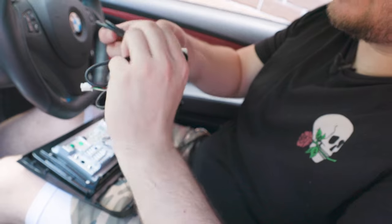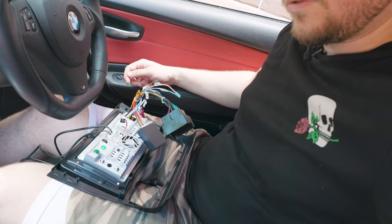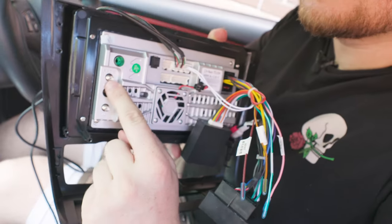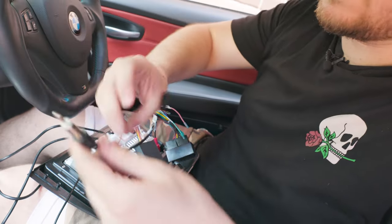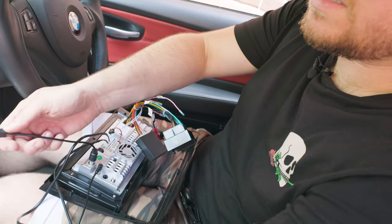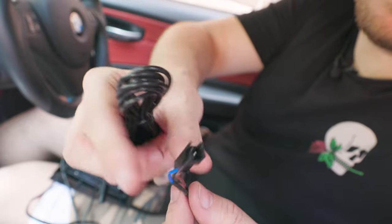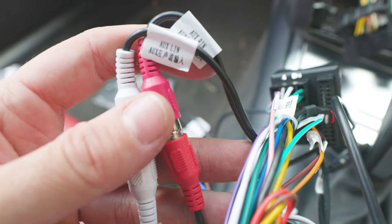Going in order: there are two USB cables — one is six-pin, one is four-pin — and there's a spot for each at the top. Then the GPS cable, which I figured out goes into this port here. The radio antenna goes straight into the green hole. This one looks like it plugs into the OEM wire from the original radio. There's also a 4G option where you can put a SIM card in, which I don't want to do. I've gone ahead and connected the audio in, and everything else is basically in a logical place.